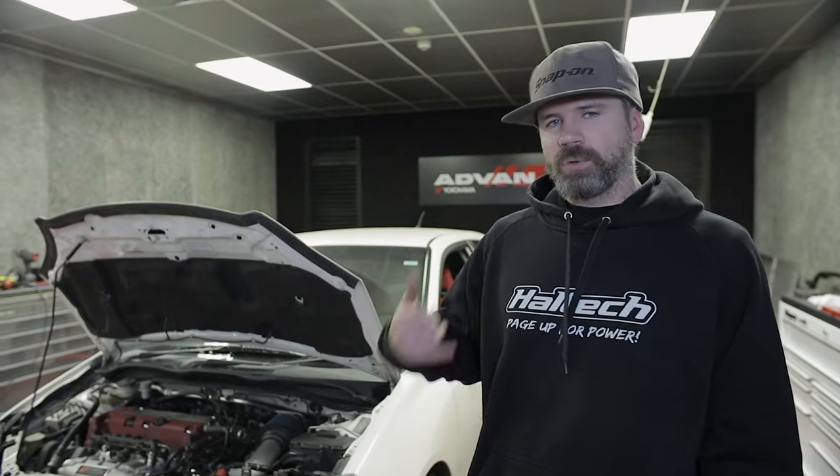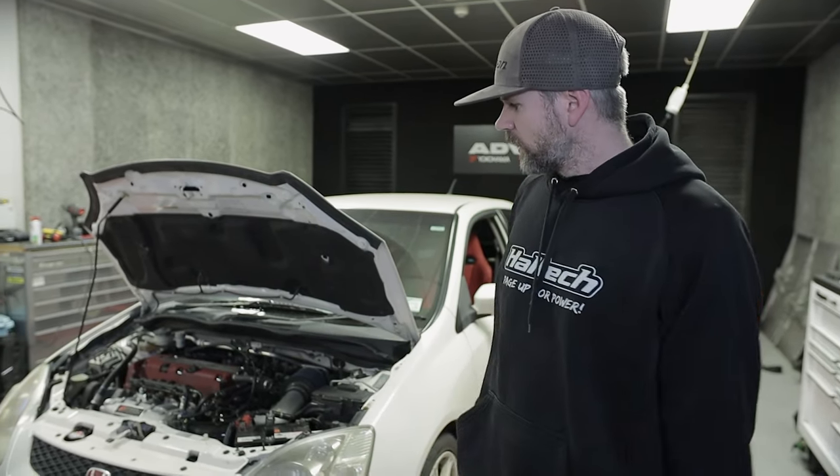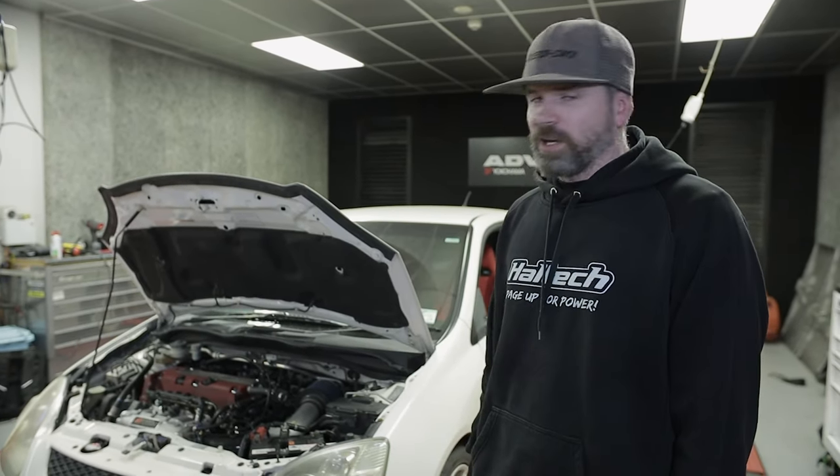So we called Link. Link were like, yeah, sweet, our ECU will do it. So chuck the Link in, and I got other problems. I should have actually looked at their base map a little bit, because their base map, Link, sorry, but it's bad. First of all, VVT timing requesting 37 degrees cam advance at idle. Car doesn't run. So because I'm a nice guy, I will make up a base map based on a factory Honda EP3 car, because I can pull that data off Hondata. I'll make something up for you.